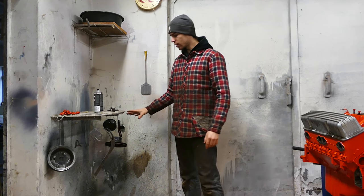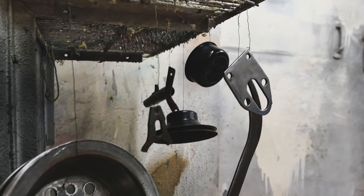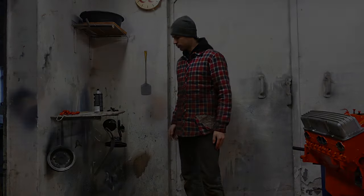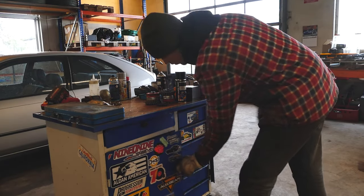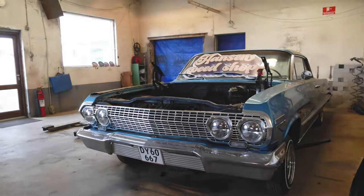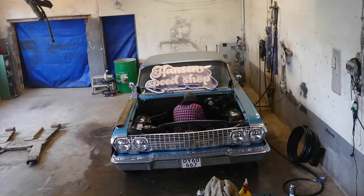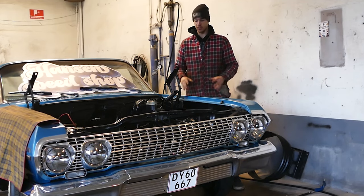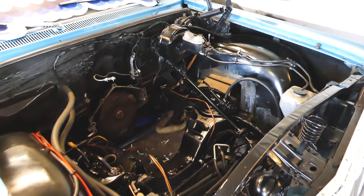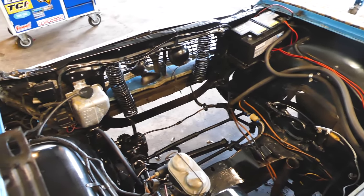Right now I got everything that's accessory to the engine ready to be painted black. I got everything cleaned up, whatever it needed to be ground down. We're going to shoot it real quick with some semi-gloss enamel paint. Pretty much just got the whole engine bay cleaned up, spray-bombed it real quick with some semi-gloss black and it looks good. It definitely looks better than before. The car is pretty much ready now to get the engine put inside of it.